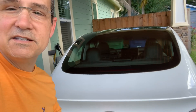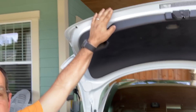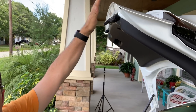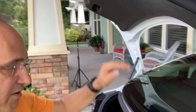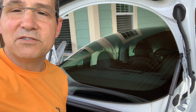When you're putting groceries in, it will go all the way up automatically. One thing to note: with the stock setup you get 77 inches of height when you open it. With this modification, you'll be about six inches lower at 71 inches, because we're going to replace these struts and add some springs. Let's look at what you need.